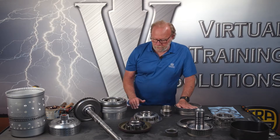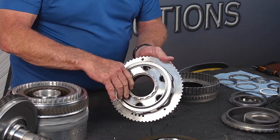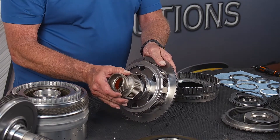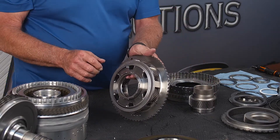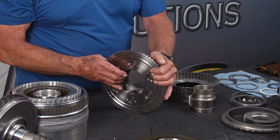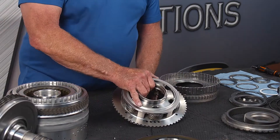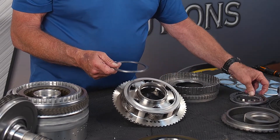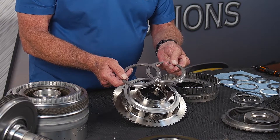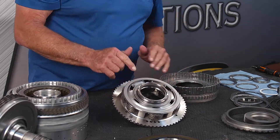These are P1, P2, P3, and P4 from front to back. Let's start with our P1 planet. There's a bearing in here that rides on the sun gear. You want to inspect the bearing surfaces to make sure they're not pitted, and look at the gear teeth to make sure there's not a lot of wobble. The first bearing is the planet-to-ring-gear bearing — there's a top and a bottom, both are interchangeable, and the flat side goes down.